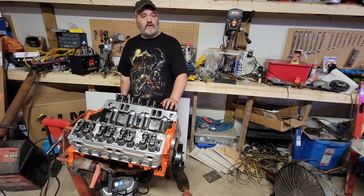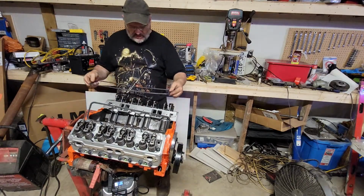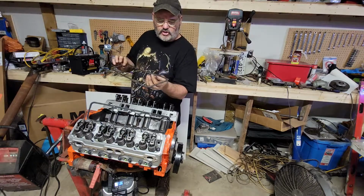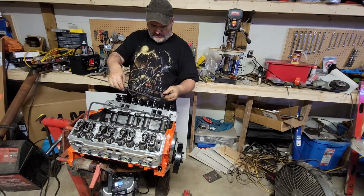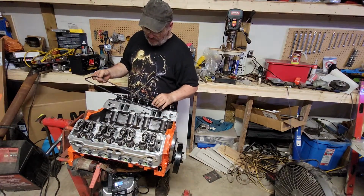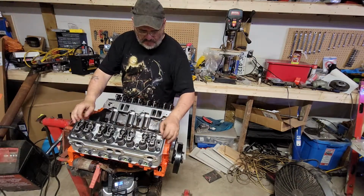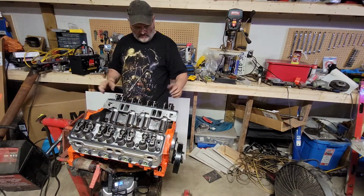I'm going to put my valve covers on, and then we can work on our intake. So these are the big thick rubber ones. They got all the ridges in them and stuff, and they got the hard inserts where the bolts go to keep you from over tightening it and causing leaks. Okay, I do not put silicone on them. I hate gluing things on. It's ridiculous. If you're careful and you clean things and use good quality gaskets, torque properly, they don't leak.